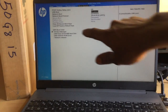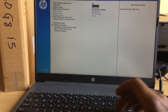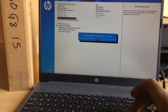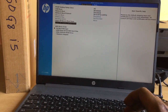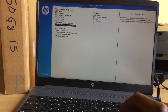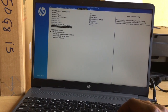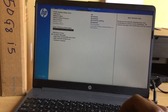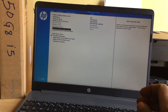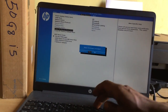Click Escape, then go to F10 BIOS system. Then you have to go ahead — this is enabled — but you have to clear the secure boot. You have to clear it and load default settings. So we have our USB there. I've enabled that and I've also cleared the secure boot.